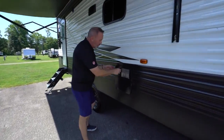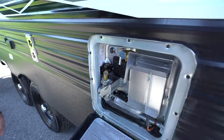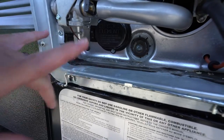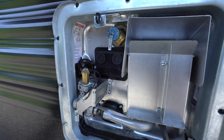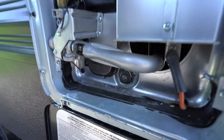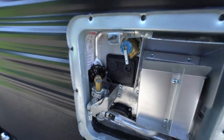For your water heater, you have a Suburban water heater and access is pretty simple. There's a little latch on the suspension — just pull it so it matches the lip and drop it down. You'll notice the electric power switch right here; right now we're in the on position. This is a gas/electric unit — some only have gas, while the bigger tandem axle models have both. Over here is your propane igniter, your anode rod, and the pressure valve up top. If you have extra water in there, pull that to release pressure. If you need to reset, you have your double reset right there.